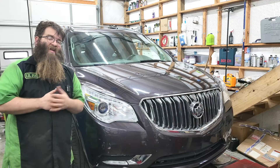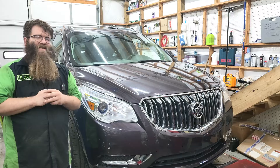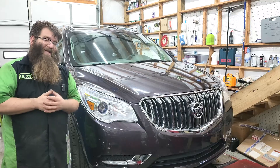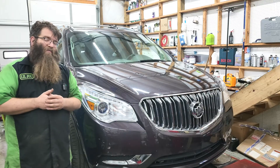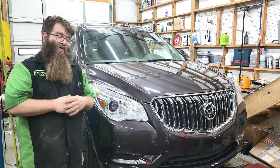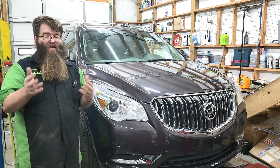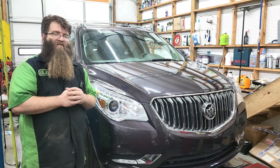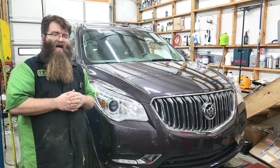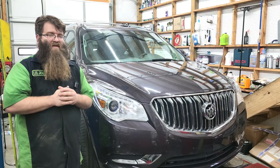That's going to wrap up the Buick. We did a service bay test — it's a sequence of driving and idling to get it to pass and complete the monitor. The monitor will also complete in a couple days. I'm pretty confident in this repair because I was able to verify the issue and verify the fix. The customer wanted GM parts, that's what we got, and it actually cost about the same as aftermarket. The part cost about $50, and between diagnosis and installing it, probably about an hour of labor. Hopefully this had some answers for you — we'll see you on the next one.